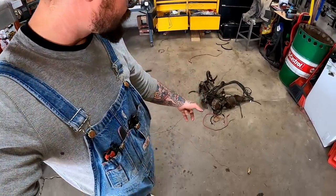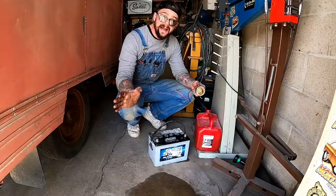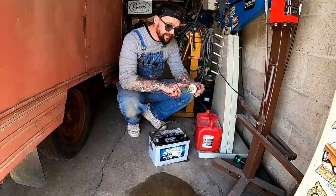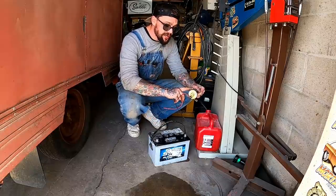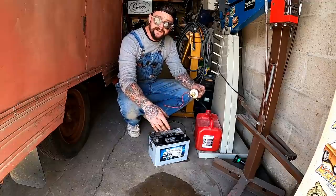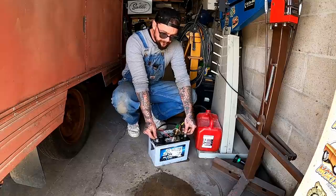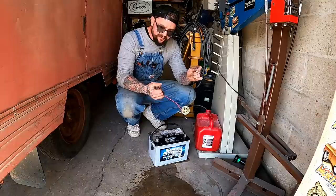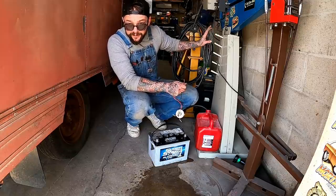Now, after seeing those jumper wires just burn up, well, I was using another set for our fuel pumps. I tested all three like we're testing right here, except I was using them jumper wires. Now, these fuel pumps, if you don't give them enough voltage, they won't pump. I know that from trying to share one of these with a coil supply wire once. It wouldn't work. It kept killing the truck. So I thought it might be a good idea to test this without them jumper wires, and well, hey, looky there, riddle solved. I don't recommend doing this. Sparks and gas probably ain't a good idea. Got my fire extinguisher right there. I'm always ready.